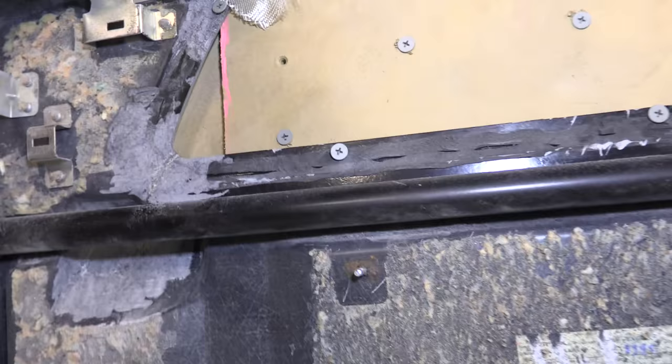So you'll cut out your pieces. Here, I've got lots of them, and once you mix your resin, it's go time, so you want to start applying them all. I'll get a bunch of these pieces cut out to roughly the right size and test fit them. Position-wise, I test fitted this like three different times, so I know it's going to cover all the crack and all the area that I want it to cover.